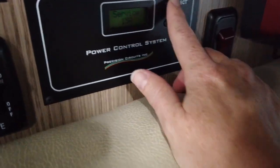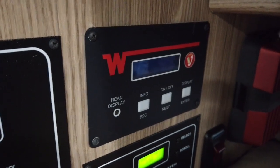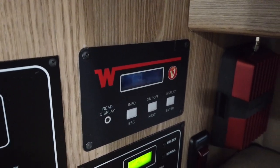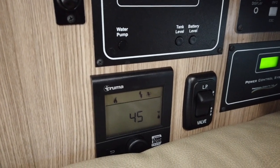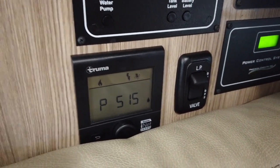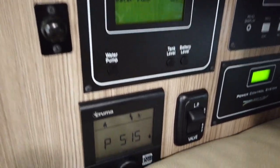And then of course, I'm over here got her down to 15 amp service. And I think I got her set on 10 max branch amps, but don't hold me to that. Basically, lower your max branch amps until you stop popping breakers. I have actually not popped any breakers in the shop because I kind of got this dialed in at this point now, and I know what's on my circuits in my shop. If I'm plugging into somebody's house, they don't know necessarily. And then I'd probably crank those max branch amps down to 5, just so I'm not hunting down breakers all night long.